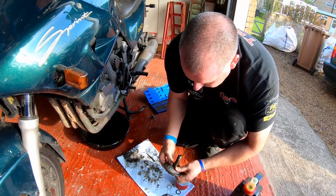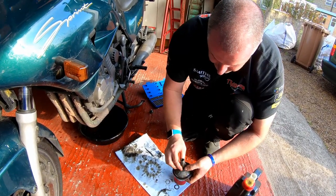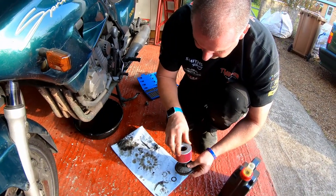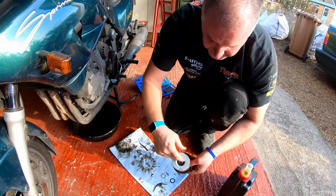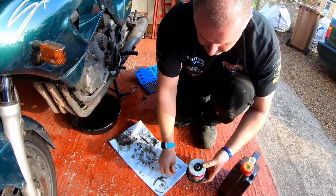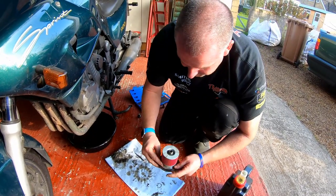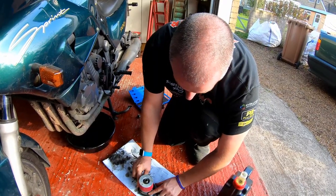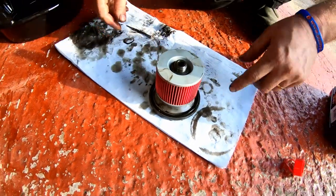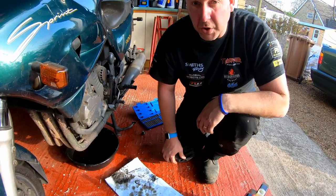Just a little bit of clean engine oil on the end of the finger, run it round — what this will do is help make sure the seal doesn't pucker up as you're screwing it in, and that it stays in its location and doesn't pinch and cause a leak. Now we need to pop these components back together: the spring goes on next, then a washer, then the filter — making sure those little seals inside don't pop off — and the washer on the top. That is now ready to reinstall on the bike.